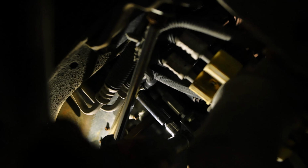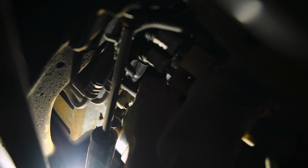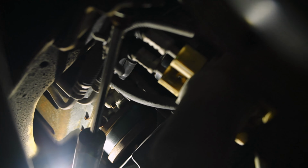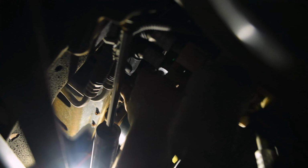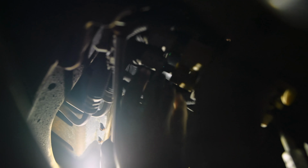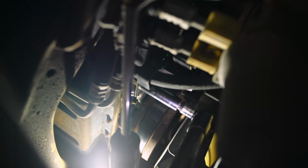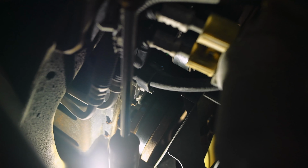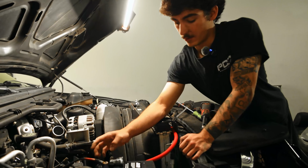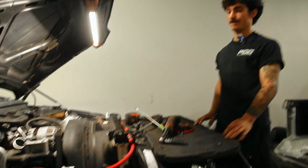Make sure that's nice and tight. So here's the starter feed. We're gonna grab our bracket from earlier. Same thing, right about there. And then I'm gonna tighten this down and then just clamp this shut. Just like that. For this factory one, we're just gonna need to drill it out to 3/8 so I can attach it to here, and then we'll start buttoning up the passenger side.